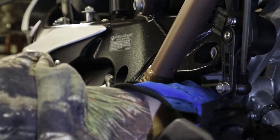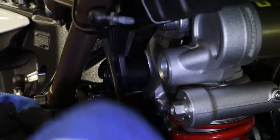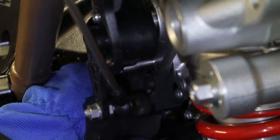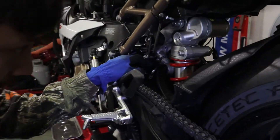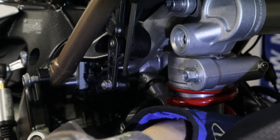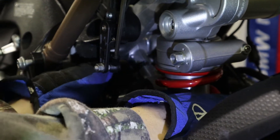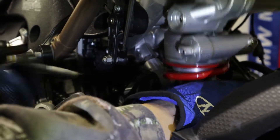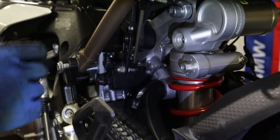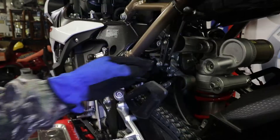I'm going to take it back in a little bit and probably hand-tighten it or use the wrench again. Now that we've got it very loose, you can only get this bolt out so much with the tools. You need to lower the bike a little bit, drop it down, and play with the shock to release the tension. Then you can unscrew the bolt by hand — there's a sweet spot inside there that will let you unscrew the bolt all the way.